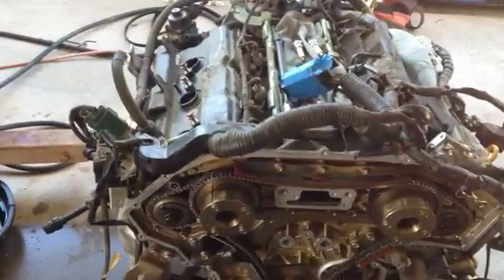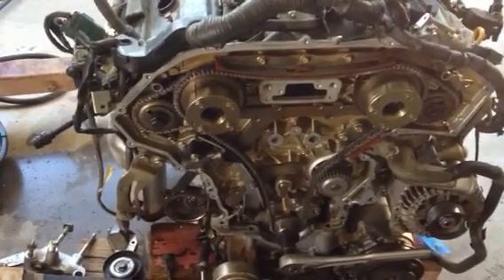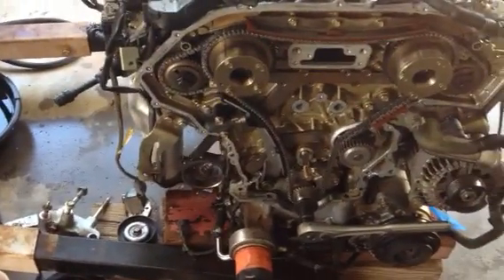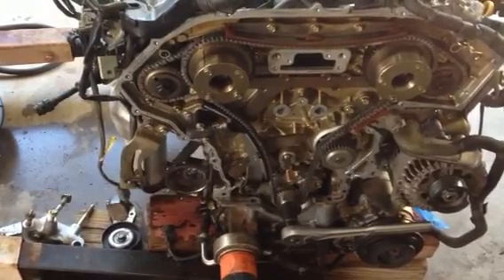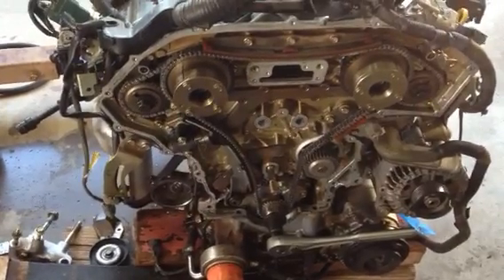There's actually two positions of top dead center. You can set your engine at top dead center on compression stroke or top dead center on an exhaust stroke. It can be a little confusing because you'll end up lining up your crank pulley with a marking on the case and think it's top dead center. But you're going to need to pay attention to make sure it's on compression stroke.